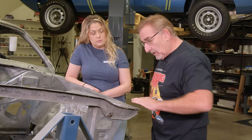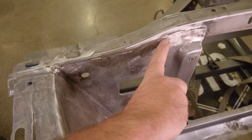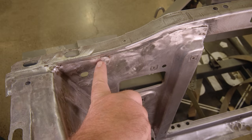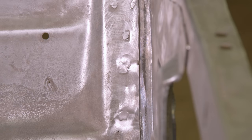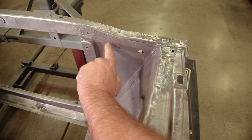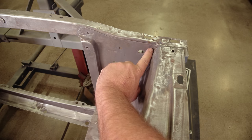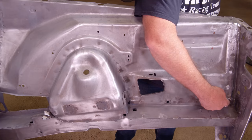I had already familiarized myself with this car and knew what direction I was going. But it was so intricate — something we haven't seen before to this level. That's why I got Alyssa involved. If you just even look at this area in general, it looks like it's been worked. You see all the little welds that have been ground down and cut down? That should be a nice pinch spot weld all the way down. But if you look down through here, those welds have all been plug welded. I think that baffle right there started life on that apron — I don't think it started life on this one.